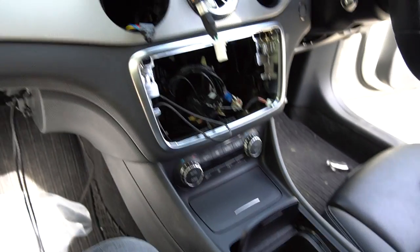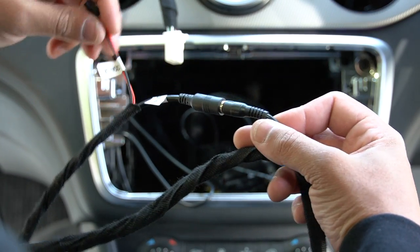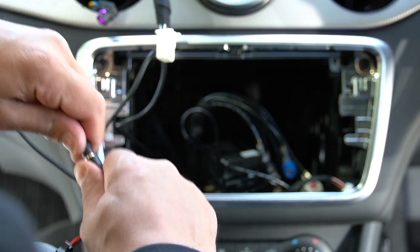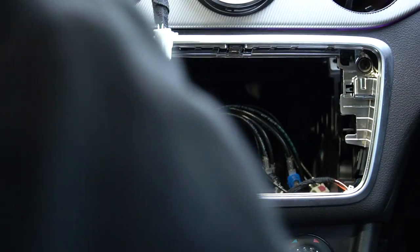The last section is the main harness. There's a little speaker on it — disconnect it, you don't need it. The white twisted pair cable you also don't need. This section gets done behind the radio. Very important: there's an audio out connection — unplug it and plug the new one in. That's the most important connection, otherwise you won't get sound. Then tape it up. This is the screen connector — run it through and get as much of the bulk out of the way as you can.